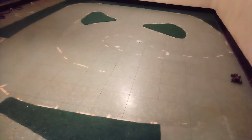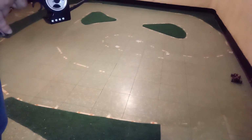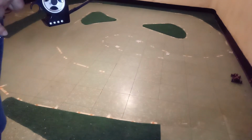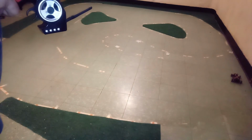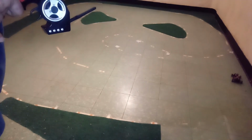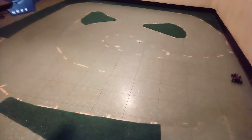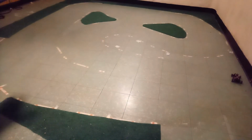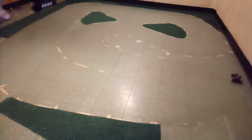So anyhow, coupling that with the camber and the caster of the front end is what makes the car drift predictably, along with the weight, the proper precise balance of the car, and a little bit of suspension. All those elements have to be just right so that the car can drift into the turns predictably, come out of the turns predictably, and enter the next turn. When you have full control, there's proportionality over the radio, the throttle, the steering, all that.